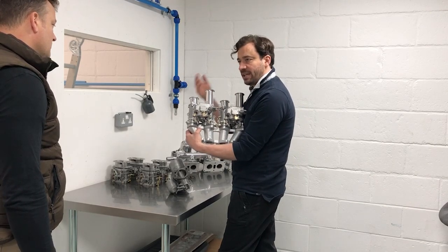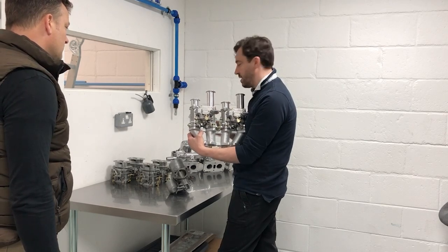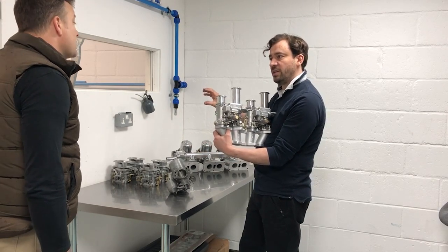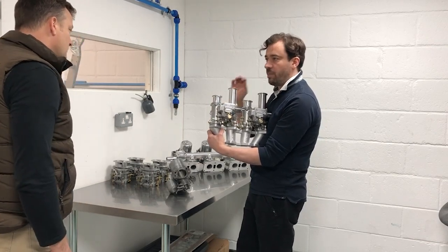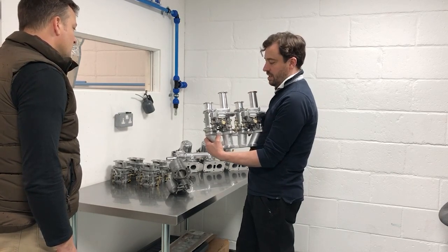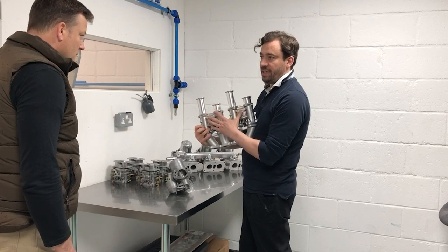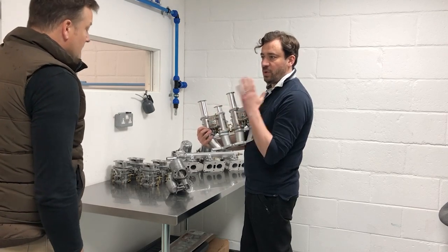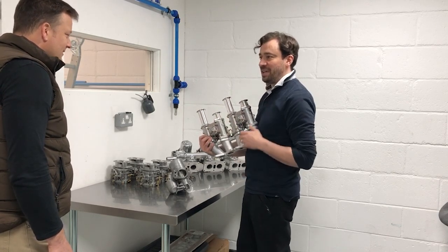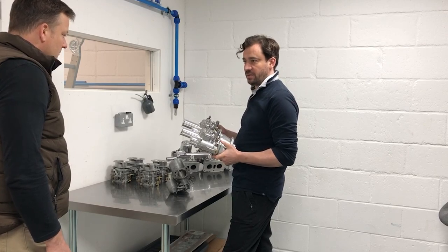The disadvantage to the Italian carburetors over the SUs is that tractability and low-speed response is likely less if you're running in part-throttle settings - they're not quite so optimised, because as I was describing earlier, the SUs have that changeable, adaptable venturi that changes according to demand. The Italian carburetors don't - they're just one big open hole. However, in terms of crispness of response, these are the ones you want because they get the air accelerating up very quickly. Also they have throttle pumps that pump in a dose of fuel each time you put your foot on the accelerator, so you get a good pump of extra fuel that gives you that extra wumph. So these are very much favoured by the racing and fast road fraternity.